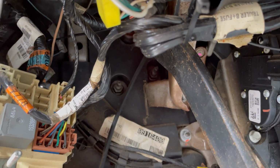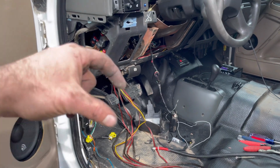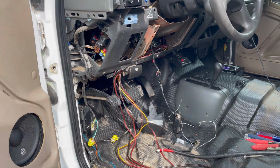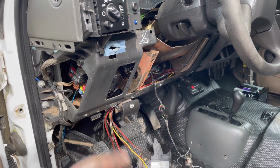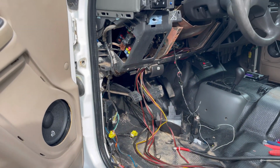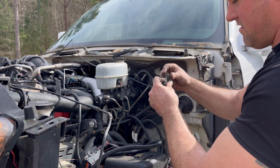Next is the four bolts way up in there for the hydro boost, and disconnect the brake pedal. Yeah, I can't film that. It's ridiculous. But there's a wiring harness for the brake pedal, and this weird little clip that goes over a bolt that basically holds the plastic thing where the wiring harness clips into it, that makes your brake lights turn on. So basically that's all it is, a little sensor. Just now getting the steering column out. Right there.